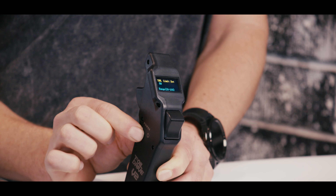On all controllers this is the same. We use the cruise control trigger — press it down and tap the power button — and now we're in the menu. We can see a little yellow arrow in the top left-hand corner pointing at pairing. The second option is our throttle limit menu, so we need to move that yellow arrow down to it. A single press of the power button moves the arrow down to throttle limit.